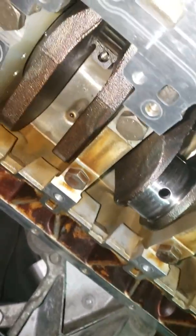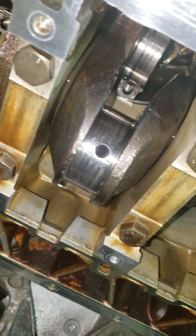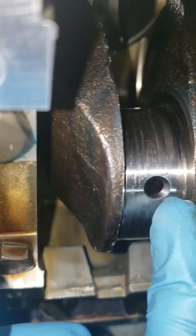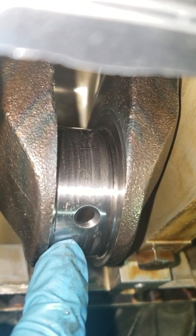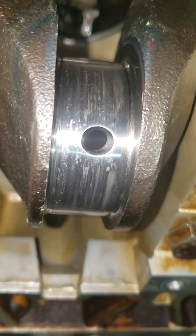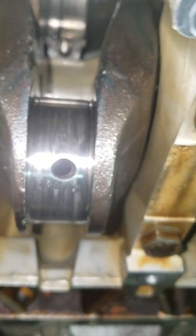Underneath the car now, I just want to show you what the journal looks like on cylinder number four. It actually doesn't look all that bad — I've seen a lot worse. There's nothing here that I could catch my finger on, so I'm going to try to clean it up with some sandpaper and see if we can get this engine to run again without needing to tear it down, drop a new crank into it, new rods. We'll try to save this thing. Those might be stress cracks right there on the surface of the journal — can't really tell.